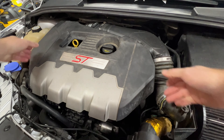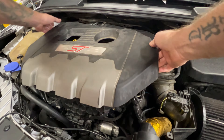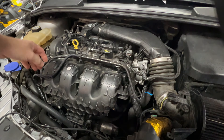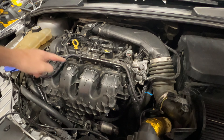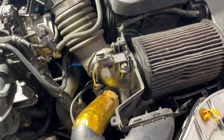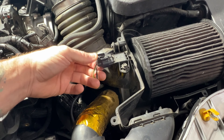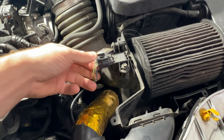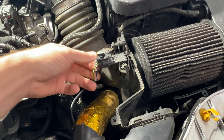The first thing you're going to want to do is go ahead and remove this engine cover — this will just kind of snap off. So just lift up on both sides. You can see it just kind of pops off of these little ball things here. Next, you can unplug this temperature sensor here. Just use your thumb, you can see that tab lifts off and then just pull off.